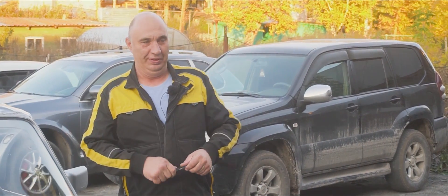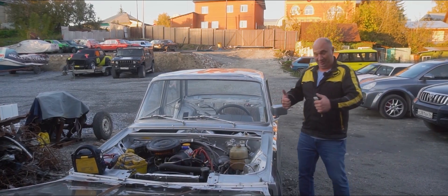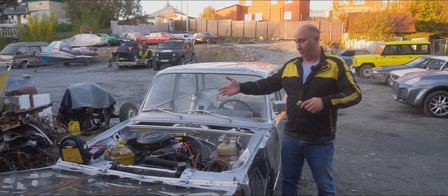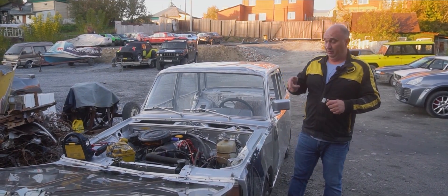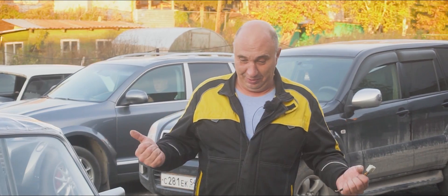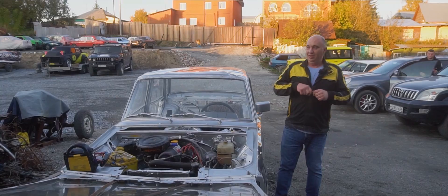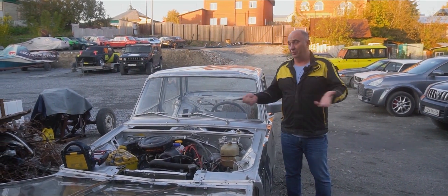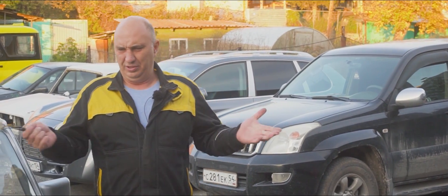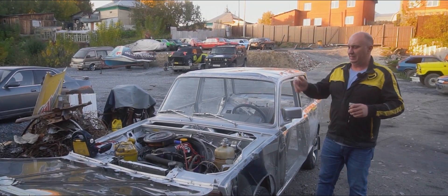And that's as much damage as we were able to inflict, aside from hooking it straight up to a power outlet. What a curious experiment we just did. So 220V tripped the circuit breakers, but nothing inside the car gets fried — that's pretty amazing. Even the switch that was done in by 56 volts from the alternator — 220V spikes did nothing to it. I have no idea why. It has to be some mysterious aspect of our domestically-made automobiles. The car is still with us. You saw us make that charging setup, which seemed like a ridiculous enough idea, but as a matter of fact it worked. We don't know what condition the battery will be in after a charge by this method, but it should survive since nothing spectacular was happening — the liquid isn't boiling, it most likely isn't crumbling to bits.